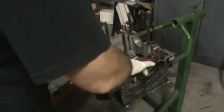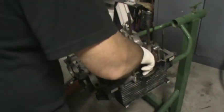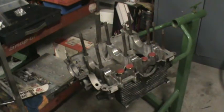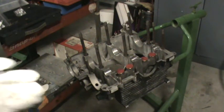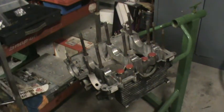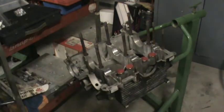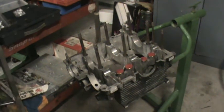We're putting a little more lube on these. Remember, this is cam lube that comes with the lifter manufacturer. They started making this stuff red because everybody thought lifter lube was moly, and people were using moly grease on their camshafts and wiping their cams out. The break-in is critical on a flat tappet cam. You want to follow every precaution when assembling a motor with a flat tappet cam — they can be troublesome to break in. Comp Cams makes an additive you can add to the oil — it's a break-in lube with extra zinc and pressure additives for the break-in process.